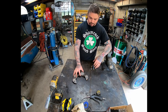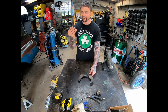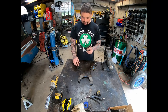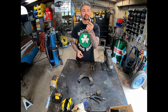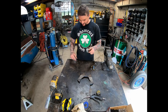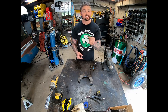And basically what we need to do is offset this bracket an additional 3/8, and for the two studs that go behind where this bracket is, you take 2 1/2-inch nuts, run them down stacked on top of each other, all the way down, which leaves about 1/8-inch of thread sticking out, and we're going to use the belt sander and sand those threads off, get them gone. It still leaves enough threads that when all this is tightened down, they stick out past the lock nut. So the 3/8 offset and losing 1/8-inch there is enough to be able to get these studs in and out.